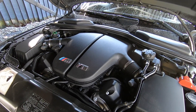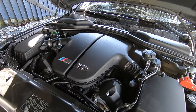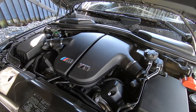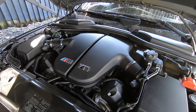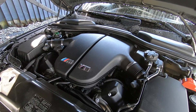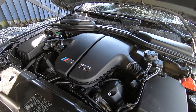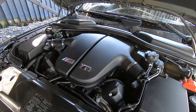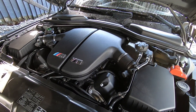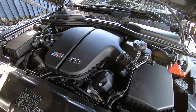So what parts make up the Vanos system and what does it look like when they start to fail? First, you've got the wiring and the wiring connections to the solenoids themselves. Operating current can become compromised through wiring degrading, especially if it's had contamination from oil leaks. The connections may also require cleaning. If oil leaks have been present, once the oil gets into your wiring harness, it can start to wick up the inside of the insulation — I've seen it many times.